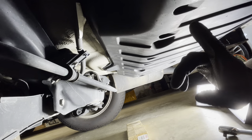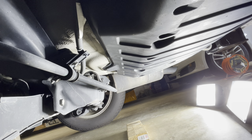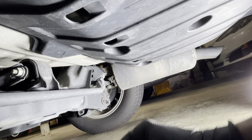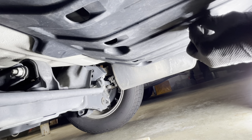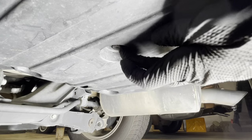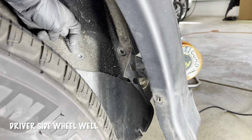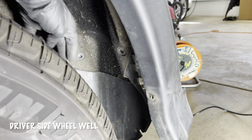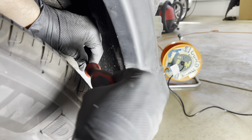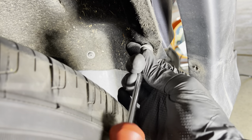I've put in the three bolts, just hand tightened to make sure everything fits, and now we're going to tighten them down. We're going to put the clip back in place here, making sure the hole is lined up first. There's the center clip pushed back in. Now we have to put in the two Phillips screws here and here to reattach just this upper portion of the underbody panel — and there's that white clip back there that's going to tell you you've got that threaded in the right place.